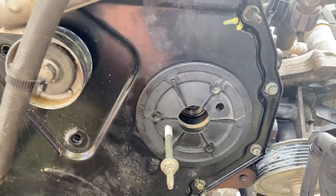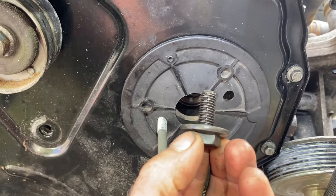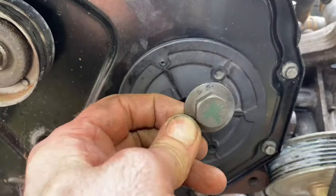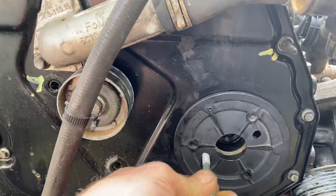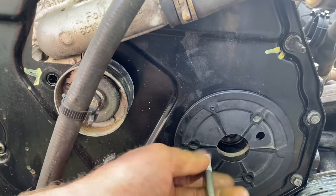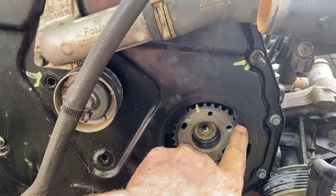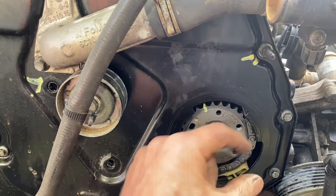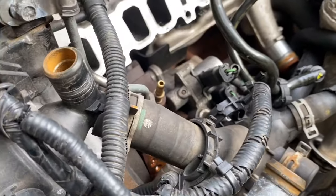When they pull or crack it from the pump, the actual bolt holes in the plastic are going to stop my timing chain from moving. So in theory I'm hoping this thing is going to mimic the tool for holding the gear in place off the pump. Once I've hopefully cracked it by tightening these in the transit - it's a 2016 2.2 Transit - I'm hoping once that's in place and I get my pump renewed, I'll be able to put this bolt back in. This bolt is anti-clockwise threaded, a left-hand thread, so it'll reinstate and squeeze the shaft of the pump back on.